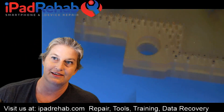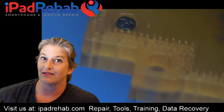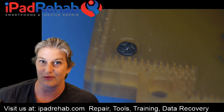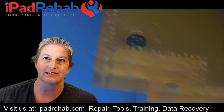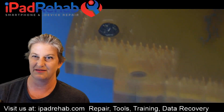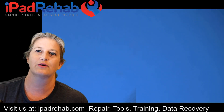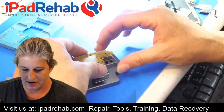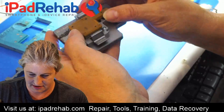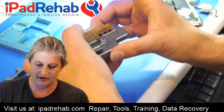What I would like — and maybe one of you guys could do this instead of me — why don't you take some of these pins out so we can figure out exactly which connections are really required for the iPhone X to boot. Not all of these interconnect connections are going to be required, but some of them are. We could probably guess from the schematic, but it would be kind of fun to just delete some of them. So this interconnect board is going to go on here, and it really kind of fits — you have to wiggle it into place, but it seems pretty forgiving.